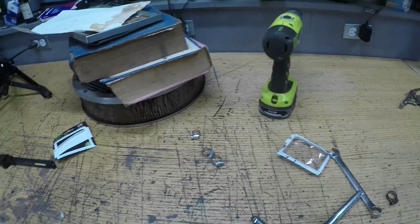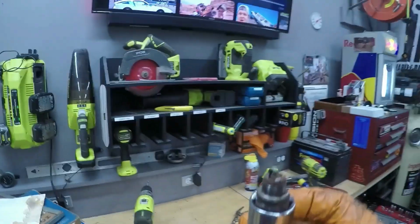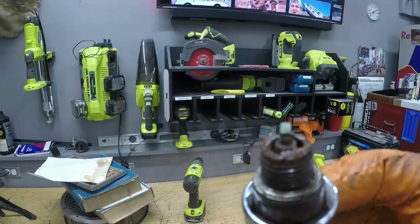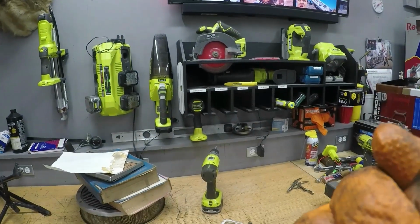Okay, I started down the passenger side, got to number 6. And as you can see, that's got rust in there. It has been stored inside since it's driven, so it's not like it's gotten water in there. It must have just drew a little moisture. So hopefully I can just get some lubricant down into the cylinders and it'll be all right.